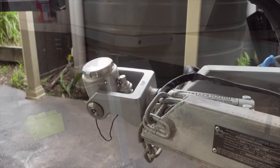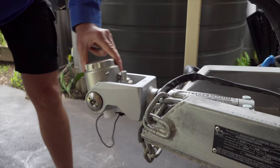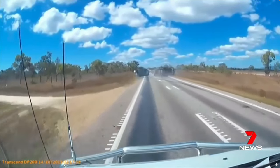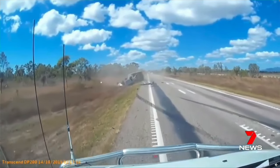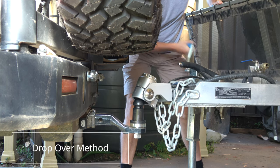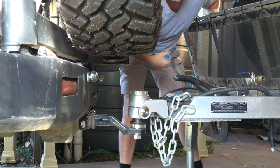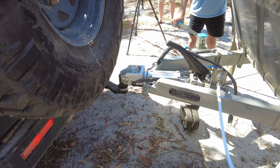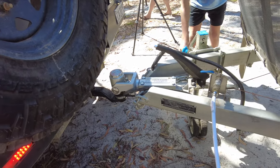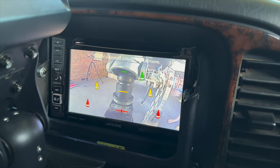Here is what I like about the Hitch Easy. Unparalleled ease of use — I have yet to find a situation where uncoupling from the tow pin took more than 30 seconds, no matter what level the camper or car sits on, or if it's on a leveling ramp. The Hitch Easy has unlimited articulation and will allow the trailer to go wherever your four-wheel drive goes, which is great for off-road use. Articulation is also an important safety factor on-road: if your trailer or van flips or rolls over, full hitch articulation means the car is not necessarily pulled in the same direction.